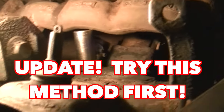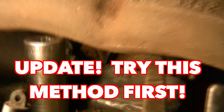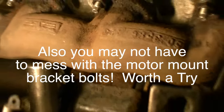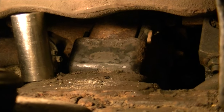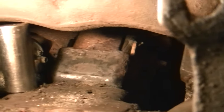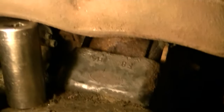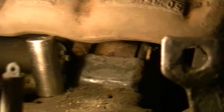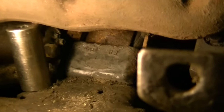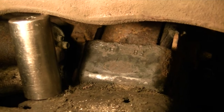Just a quick footnote — what I discovered after I put this back together: if you take a pry bar and pry right there and push up on that manifold, putting a socket right there will lift that engine up just about a quarter of an inch. You may be able to get those two bottom bolts that are hard to reach because of that motor mount frame. Try that — I was actually able to get one of those bolts on. You may not have to take the starter off, but try this first. Try prying up on the engine just a little bit, get your socket under the manifold, and you may be able to tighten those two bolts that are close to the back of that motor mount bracket.